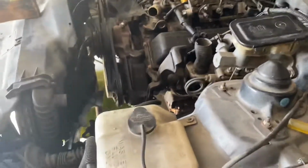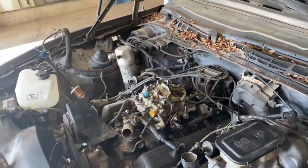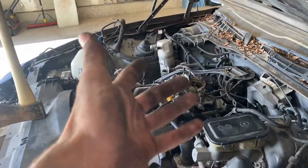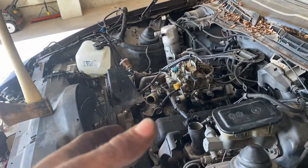All right, after a bit of a headache, all the electrical connectors have been pulled. Part of that loom wrapped around the back over to this side, and I got all that stuff disconnected. I tried to get the battery working, but nothing really worked. I'm sure there's some issue there, but I'll worry about that once we actually get the motor out. I want to make it so the headlights, the brake lights, and all the car stuff are almost entirely separate from the engine stuff, minus a few things like ECU to the key and starter motor to the key. But each one should be mostly independent from one another.